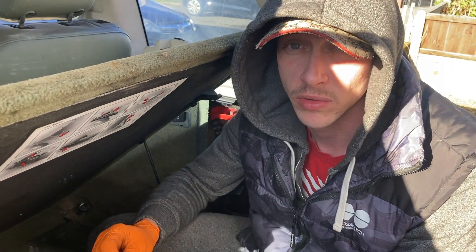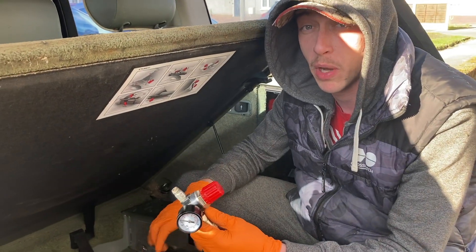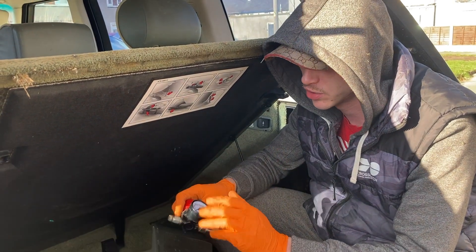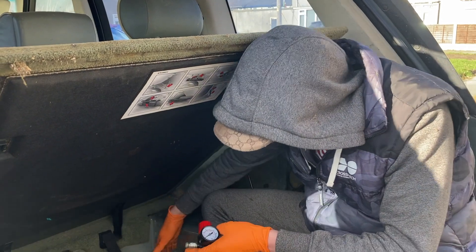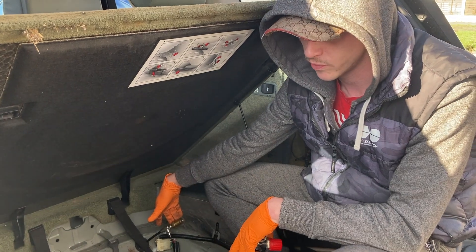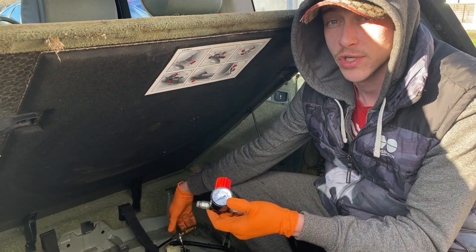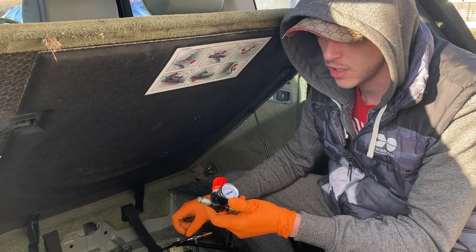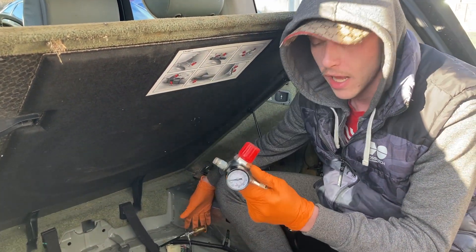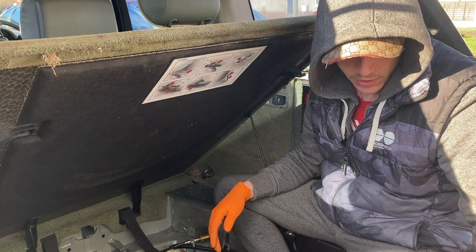Something I used to do when I didn't have a diagnostics tool — to check my compressor was producing the right air pressure — I took one of these off my air compressor: a bog-standard unit with just a gauge and a fitting, and I screwed that into the T-off point. Then I ran the car, put it into full height mode to activate the compressor, and watched the readings. So if you haven't got a diagnostic tool, you can just unplug that there, put one of these in, and you've got your reading so you can see what's happening.